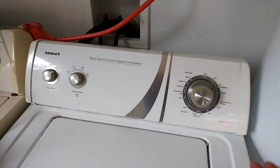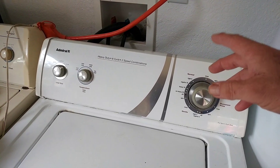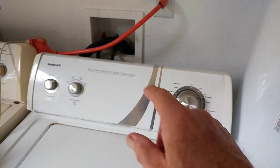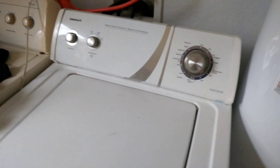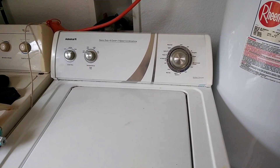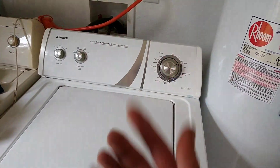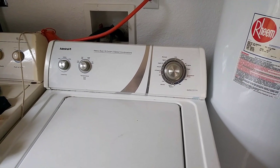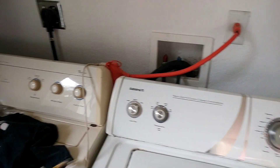You do not pull the top off. You go into the back — there are five screws to remove. The wiring harnesses are held into the back of the machine with little plastic clips. You have to pop all those plastic clips off, and then it allows the back to raise up toward the upper side of the washer.